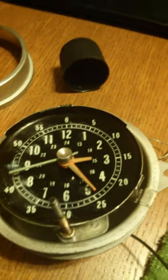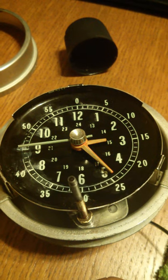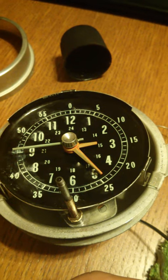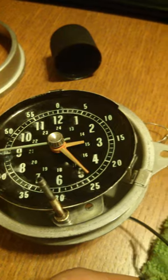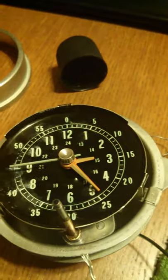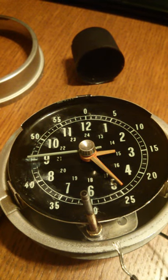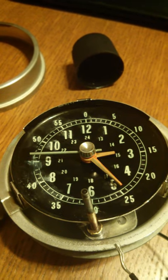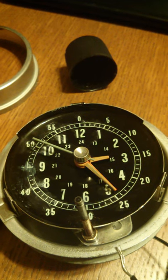I'm repairing a 65 Impala mechanical clock and I've managed to get the internals working. The posts were burnt up essentially, so I cleaned those up and rewrapped some of them, resoldered them together and just hooked everything back up. And as you can see, let me give it power — it runs. Kind of a cool old clock.